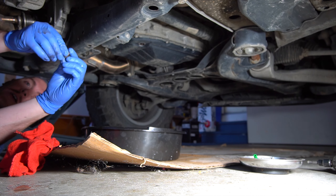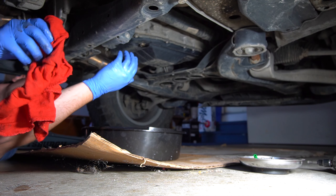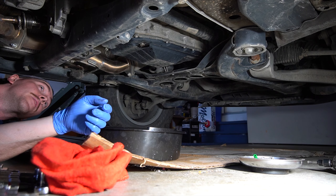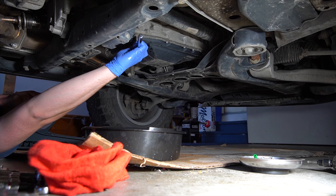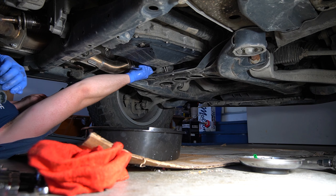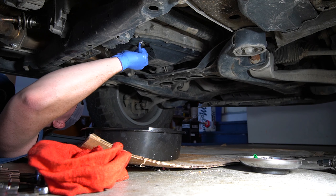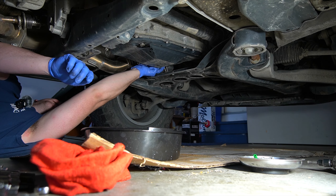We're at a little bit of a dribble, so we're going to put the outer plug back on — just snug it in by hand. Now we need to get our old fluid out, so 10 mils all the way around the transmission pan. I'd honestly recommend using a cordless electric ratchet to make your life a lot faster. These aren't very tight, so when you put them back in they won't be very tight either — don't reef on them. I believe there are 10 of these bolts.